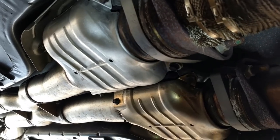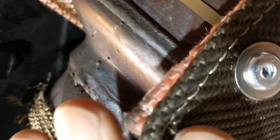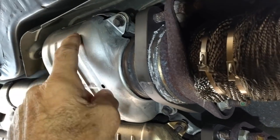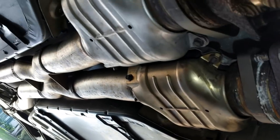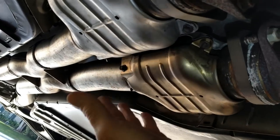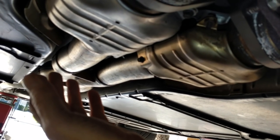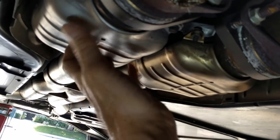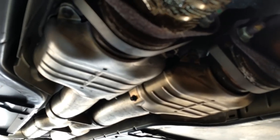By the way, let me add this bit of information. On a 2013 Corvette C6 Z06, there are four cats — two big ones right up near the engine and then two more further back. GM has got shields on those cats in the back, and it's got a shield here too. So for you guys and gals saying don't put a shield on the cat because it'll shorten its life — I have to call BS on that. You're looking at original GM parts that have to stand up to federal emissions standards, mileage, and years of use. That should put an end to that rumor. See you later, Froggy out, bye-bye.